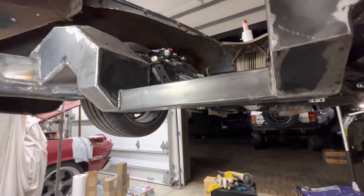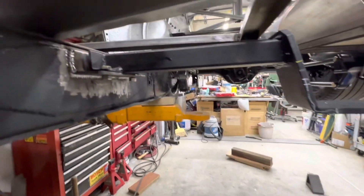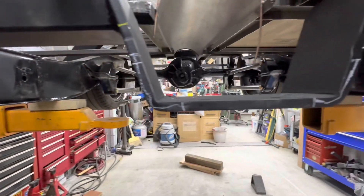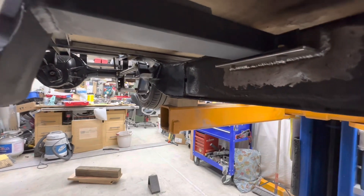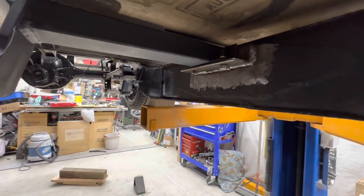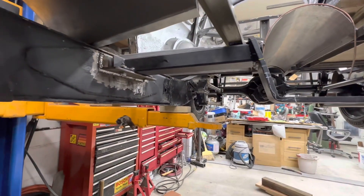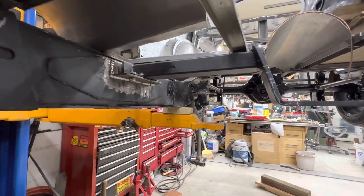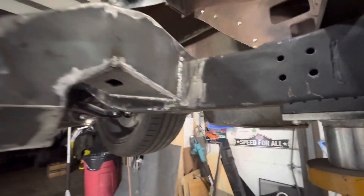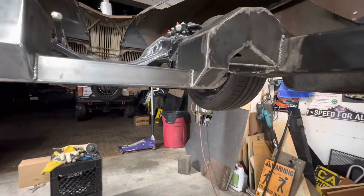I'm going to put the Por-15 stuff on there, get it cleaned up, and finish off the evening with that. For the transmission mount, I used angle iron to create a shelf that drops down a little from the underside of the floor. That's 3/8-inch plate and a one-and-a-half by two-and-a-half quarter-wall tube — pretty typical of universal mounts I looked at online. Next video will cover floors, pedal clusters, and tunnels. Thanks for watching.